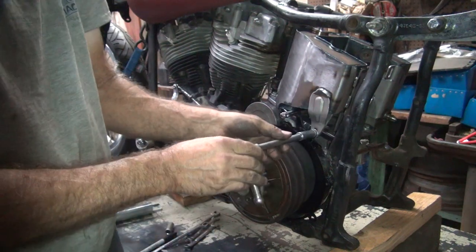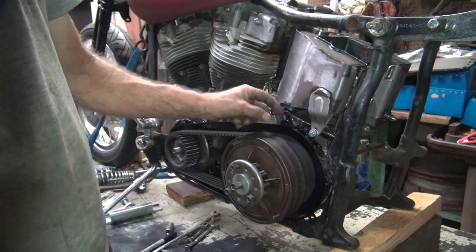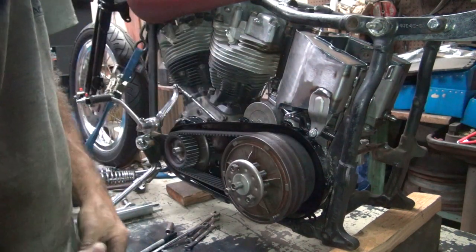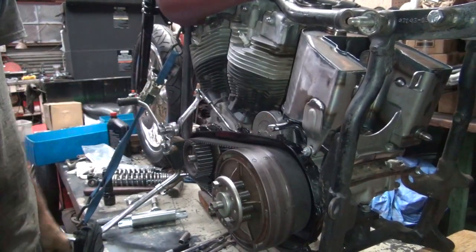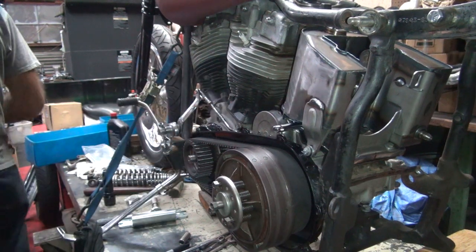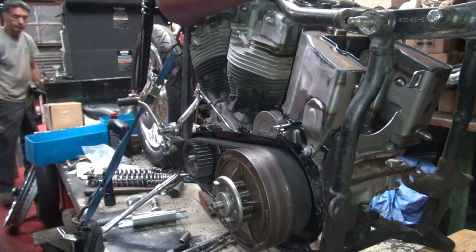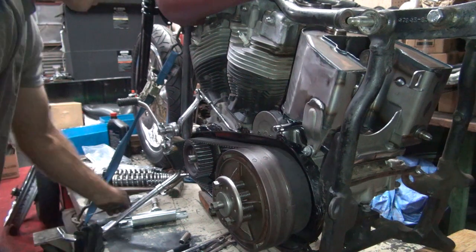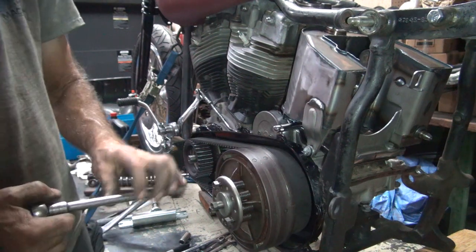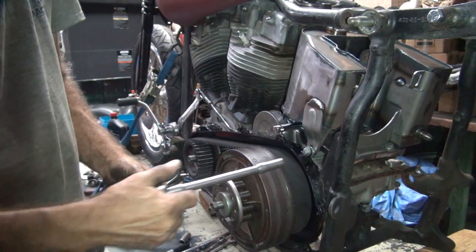Take the wrench and tighten it up. So see how the primary curve is going like this. So it was losing the tug of war because it's thinner material than all this other junk over here. We can't have that though. That's going to warp all over the place. Okay, now I'm going to loosen this up and see how much it moves. It moves a lot.